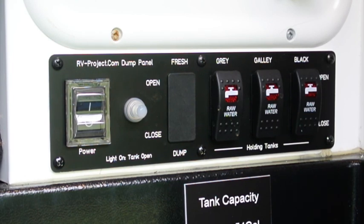And also I have a water leak monitor, and I'll explain more how that works when we get inside. I custom designed and built it, and it can handle up to 9 sensors. One of the sensors is right behind this panel. This is where one of the high leak areas can occur in these RVs, because there's tons of fittings behind here for all the valves, and you know they didn't necessarily do a perfect job installing it. In fact, one of the fittings, I probably should replace it, but I have to go in and hand tighten it about once a year.